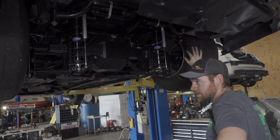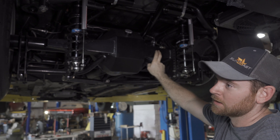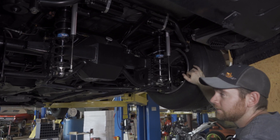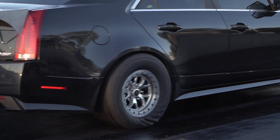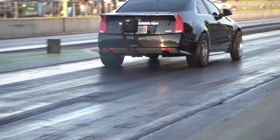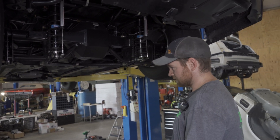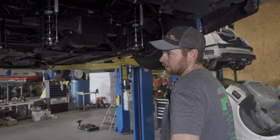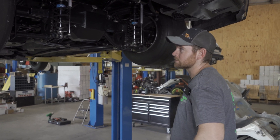Solid axle cars — you got a lot less that you can break. Joey's car, when we first built this rear end, we had 35-spline gun-drilled axles in the housing, getting the setup close to where we needed it. We were shaking a lot, countless times breaking an axle on the driver's side. So then he went with 35-spline solid axles. Since then, we've learned a lot from suspension changes and shock changes, and we haven't shaken the tire like we used to.